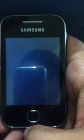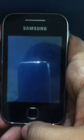It's so easy. Now we should go to recovery mode. If you don't know how, press the volume key up, press the power key, and the home button at exactly the same time.